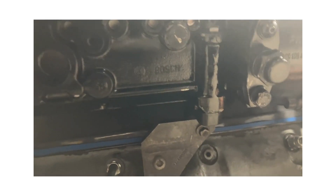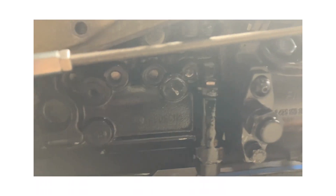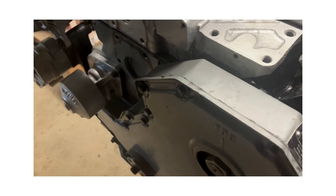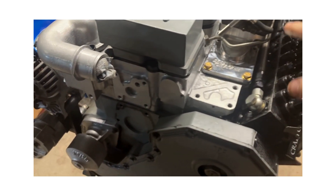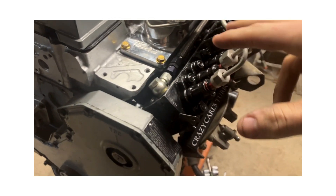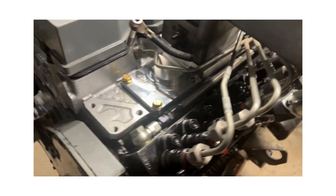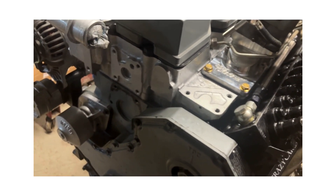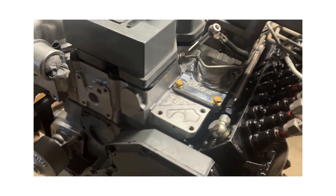That's not really the right way to do it. Yeah, it'll lube the pump for a little while, but it's not factory. Factory, they have it hooked up to the passenger side of the pump, which is already restricted and has its own oil galleries that run all over. There's a rack system in there which the governor moves back and forth — the aneroid housing, everything back in there needs to be lubed, especially that rack system where it racks back and forth to adjust the fuel delivery to the delivery valves.